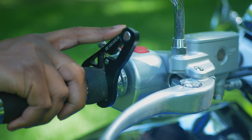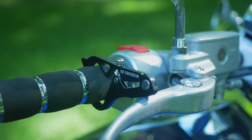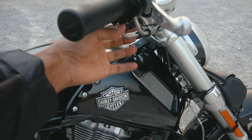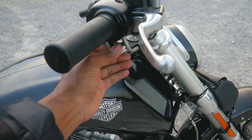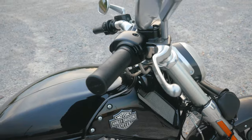Fact number three: the V-Rod doesn't have an electronic throttle, so you can't get electronic cruise control, at least from Harley-Davidson. My M109R is the exact same — no electronic cruise control or electronic throttle — which means I have to use a thumb screw to get the same effect. Think of this little knob as the poor man's cruise control. To activate it, you simply turn it in the direction to add resistance, close the throttle, and now it's locked. To release, turn it the opposite way. Poor man's cruise control.